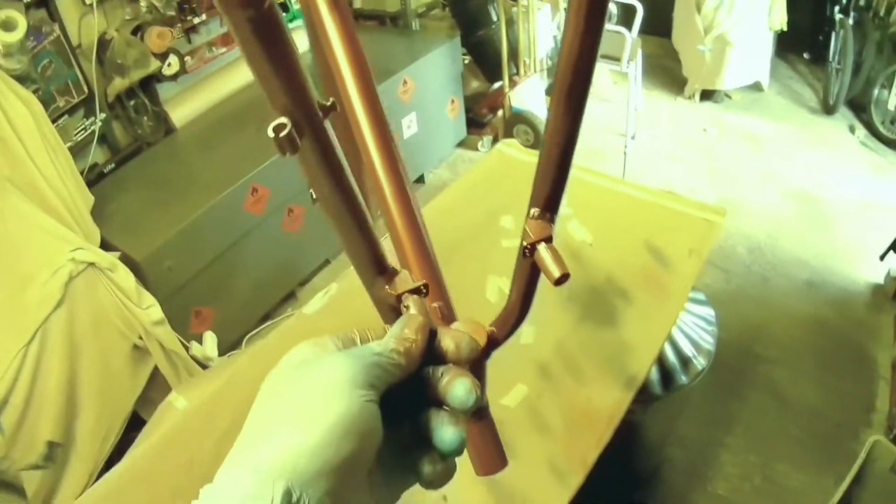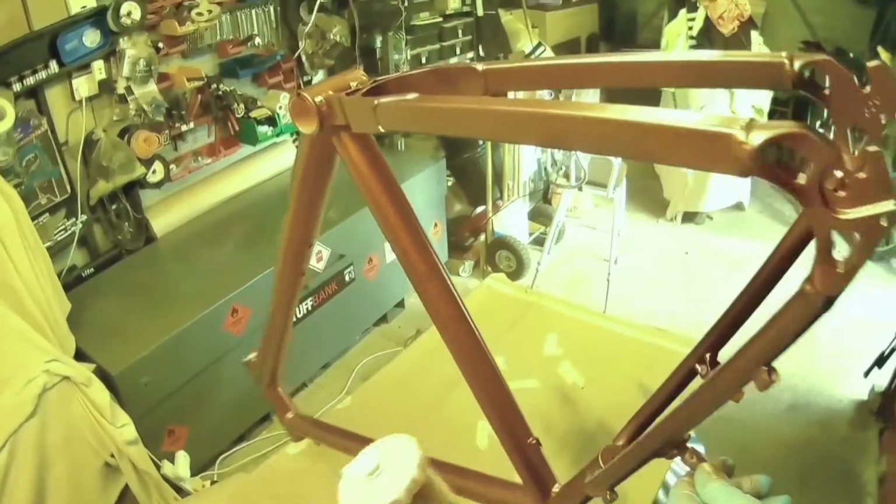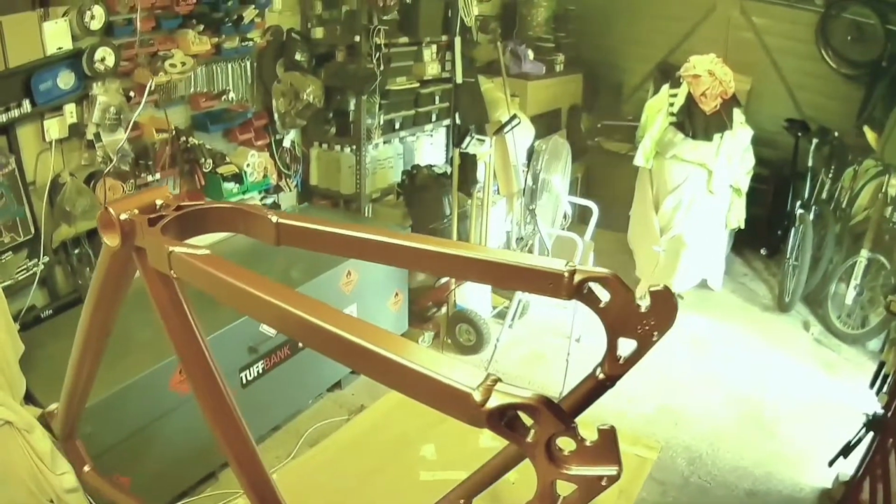I say that because it's quite intricate. If you've got a flat panel on a car and you get a few runs, you can normally use a blade to get it off, or just sand that little area down by hand, smooth it out and polish it off. And as long as you haven't gone too mad and it matches the rest of the paint, you get away with it quite easily. On a frame, it's quite awkward, especially on some of the more intricate parts, because it's not that easy to polish. You'd have to do it all by hand, which takes longer.